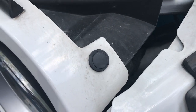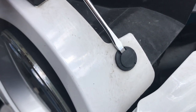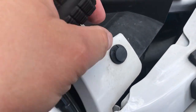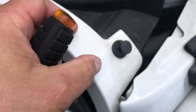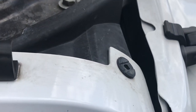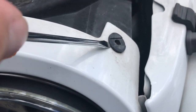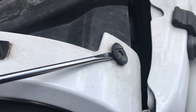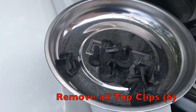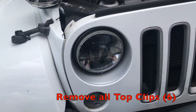Look at the clip — it's really two parts. It's got a center part and the outside part, which actually expands when the center part is lifted up. Take a flat screwdriver and pull it up. All I've done is pull it open, then take the screwdriver — careful not to scratch your paint — and pull that out. Set them in a tray so you don't lose them.